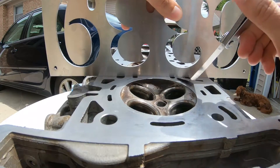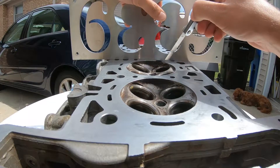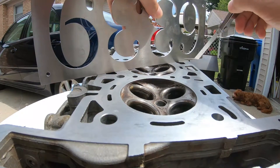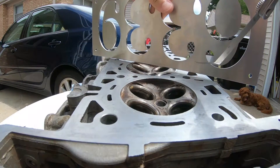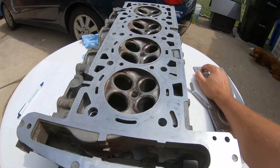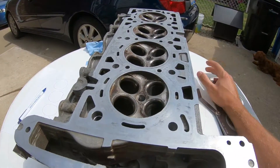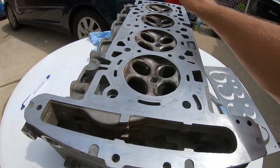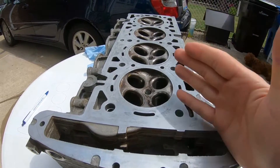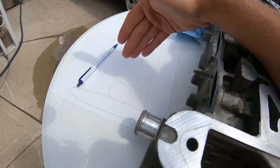Together, if it's under the maximum allowable tolerance you can still run it, or get a thicker head gasket. I've already checked all the clearances on my motor using this method and everything is nice and straight — the 0.008 gauge cannot fit anywhere in any direction. That's very good news, because I was worried this head might be warped since we found antifreeze mixed with oil, which indicates a bad head gasket or a potential crack. The fact that the surface is straight leads me to believe the motor wasn't overheating enough to warp the mating surfaces.